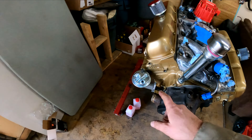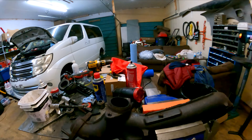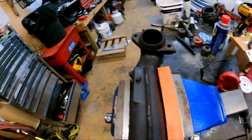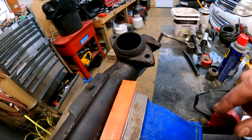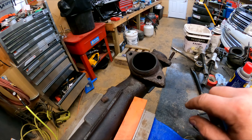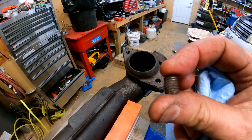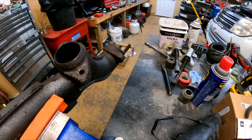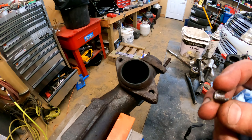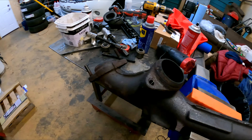The next thing I'm going to tackle is getting the fuel pump mounted. We're all familiar with the saying: every 10 minute job is one snapped bolt away from three hours of bullshit. I didn't even snap this one — it was snapped off by the guy I bought it off. Using the drill, the chisel, the hammer, and a lot of swearing, a few hours later I finally got it drilled out. Just finished chasing it through with a bolt to make sure it'll hold up.